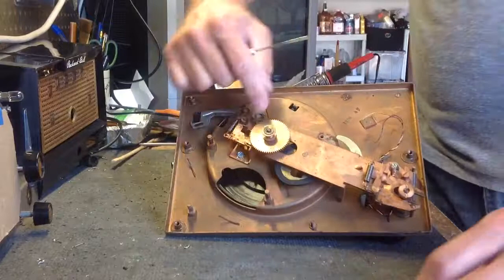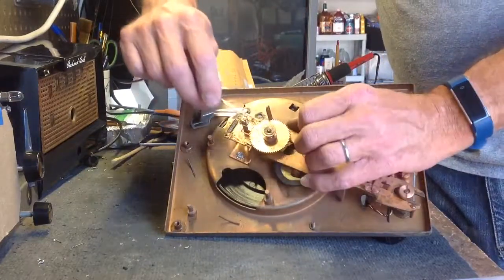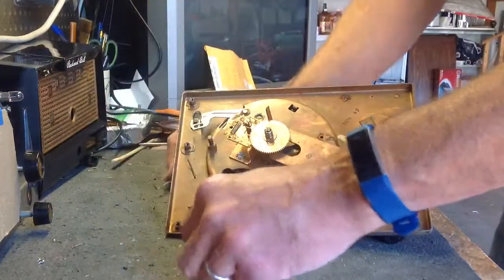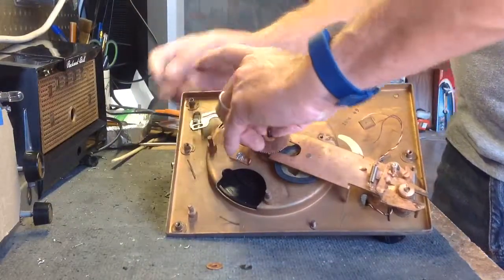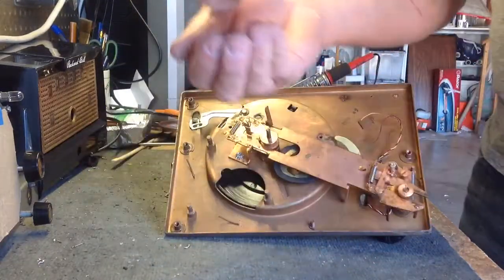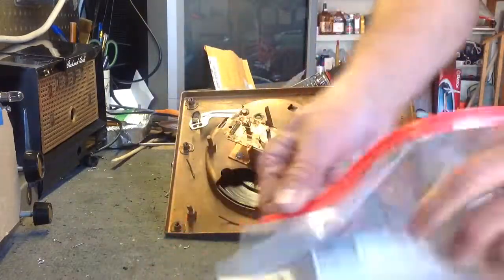We're going to start by taking this clip off, and there is a spring sandwiched between 2 washers sitting on top of this wheel, and you have to be careful about that. Push down slightly and pop that clip off, and then take those washers and the spring off. Okay, the washer is just going to come with the wheel. There it goes. Okay, so you do all of that first. And zip my Ziploc here.